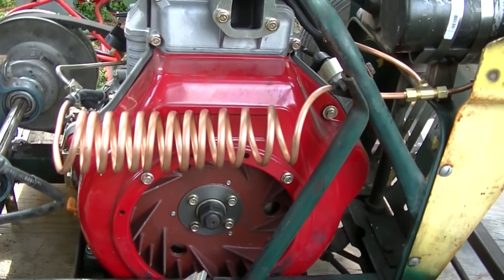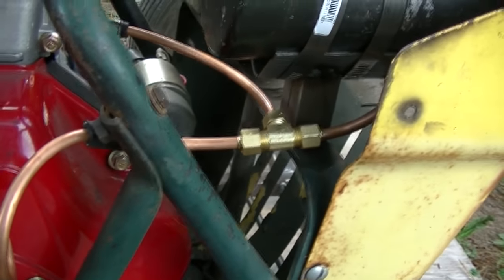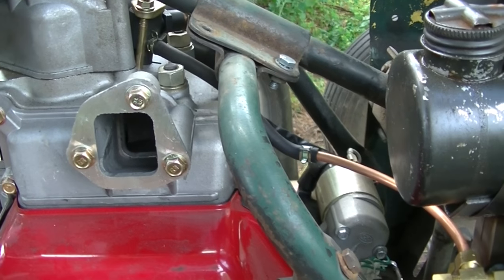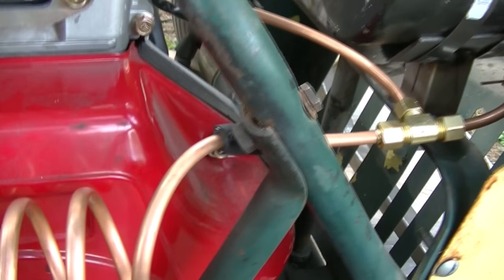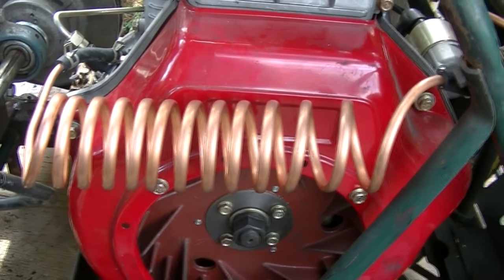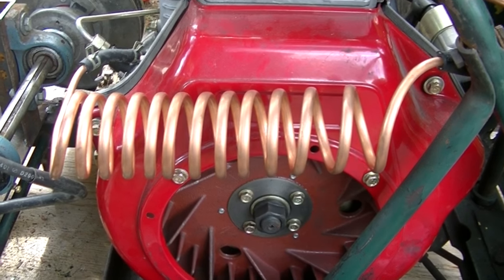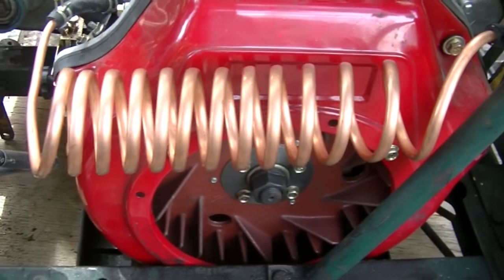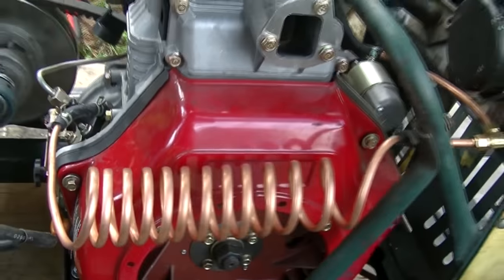I figured I'd steal a page from an old moonshine still with the copper. Coming out of the tank, it tees off and goes to the return line from the fuel injector. I'm probably going to slightly alter the routing there, but it's doing the job at the moment. It comes off the T and I've got that little bit of fuel line there just to protect it from abrasion — I will clamp it. Then I took about eight feet of quarter-inch copper line and wound it around a pipe to create that coil, which probably adds about five minutes of runtime to the fuel capacity. And then it just goes off to the fuel pump. That's the Weasel's fuel system right there.